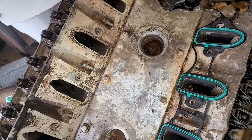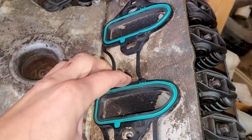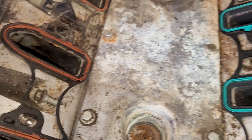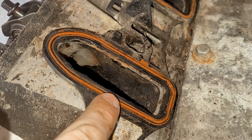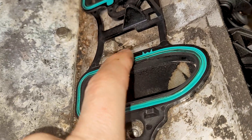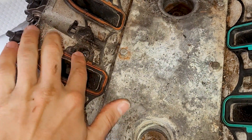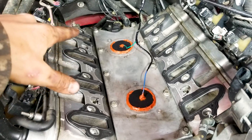I'm going to show you a closer look at these intake manifold gaskets. Here's the engine off the abandoned Chevy Avalanche — this thing is blown up, but I want to show you. Here's where the intake manifold gaskets sit. These right here are the upgraded green ones, and over here we've got the red ones. From the factory, 1999 to about 2002, they had these red ones and they realized they squish down and aren't sealing well. They upgraded them to the green type and they seal much better. If you take apart one of these engines and see a reddish-orange color seal, you need to swap it out with these.